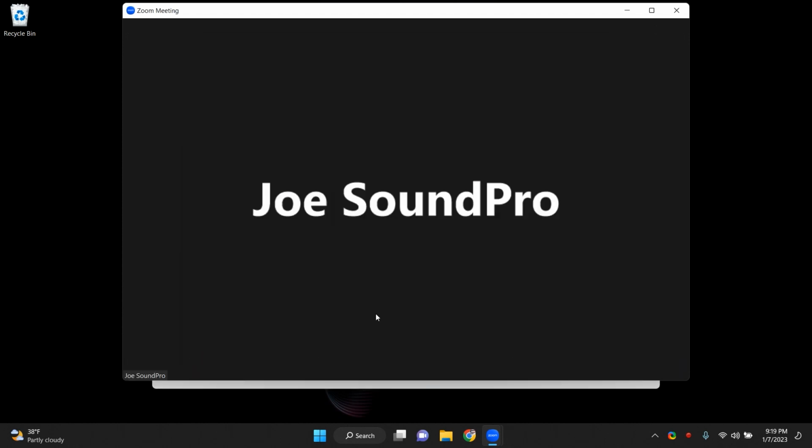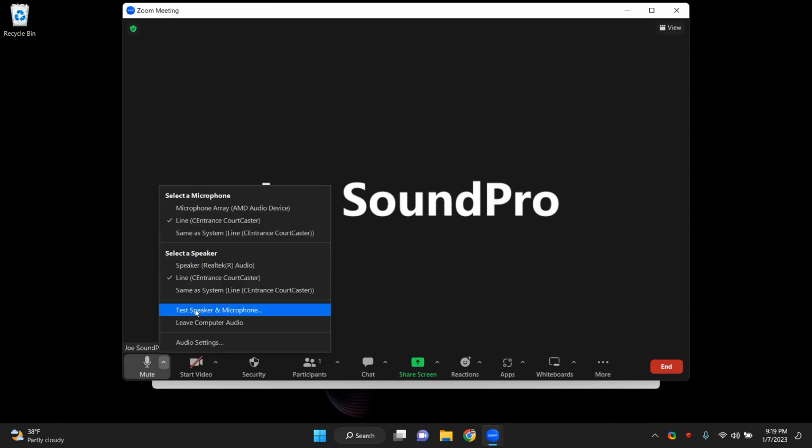The last setting you want to check is in your specific CAT software. You want to make sure that, again, the line CEntrance device is selected for the audio input. Depending on what CAT software you're using, that setting's going to be in different places. For CaseCat, it's going to be in your translate options on the real-time tab. Your input device will be this one here, line CEntrance Courtcaster, that's what it'll say.